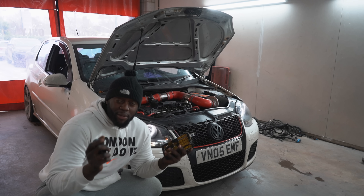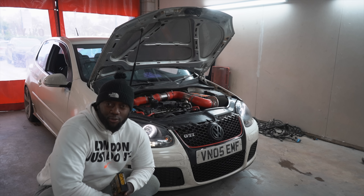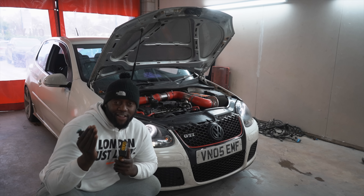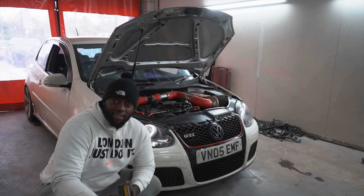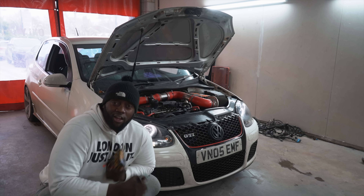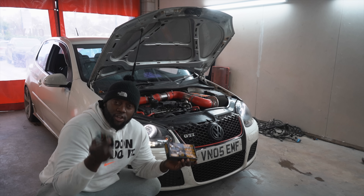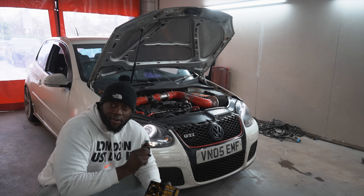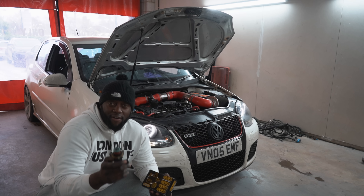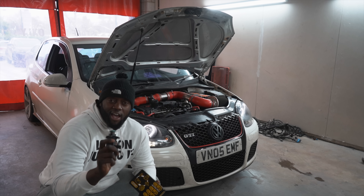So it's about a month later and I've been away. We've done so many things in that time and I've been daily driving this car — the power feels great. With the addition of the projector style headlights, those rings look amazing. And now that I've added the LED bulbs, it lights up so much better than the original lights. One of the big issues with the Mark 5 GTI is the diverter valve — they use a really rubbish design, and then you leak boost, and when you leak boost you may lose power. So I went ahead and did a bit of research.